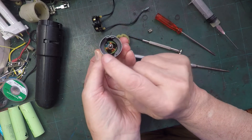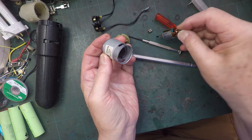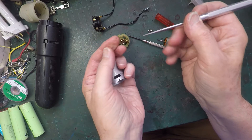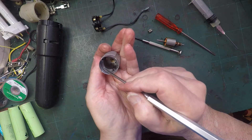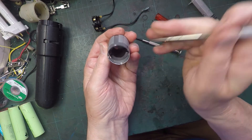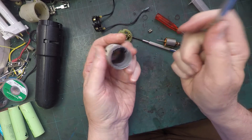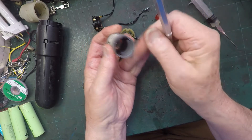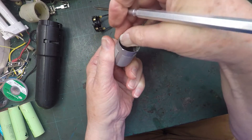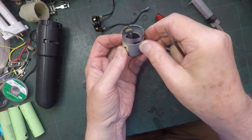This will sort of be tight because it's got two magnets in there that it's pressing against. There it comes out past the magnets. Now, what we're looking for is any debris that could be caught up. Like that. Oh, there's a little bit there. And that's a problem with these motors — if you use them anywhere where there might be iron filings, they've got holes in them to let the air flow through to stop it getting too hot. So these magnets would attract anything that's attracted to a magnet. There is virtually nothing in there so I think we're okay on that score.